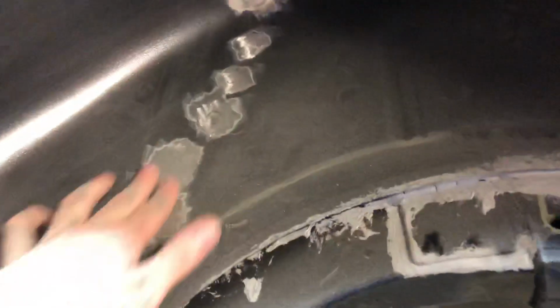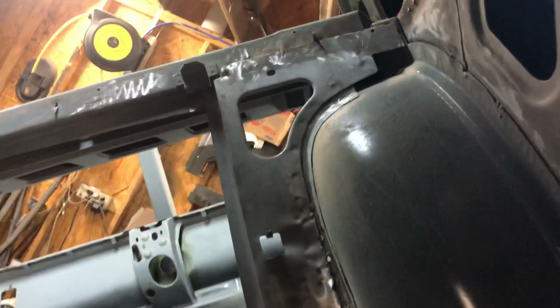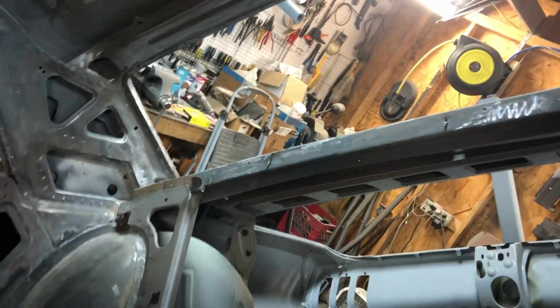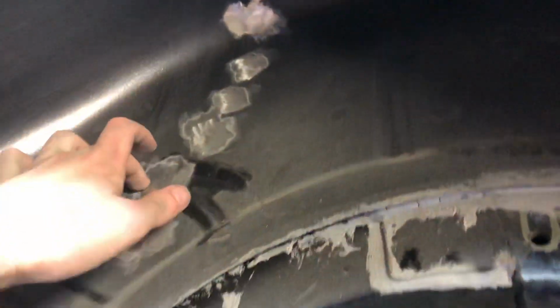All that stuff, and then of course I welded in those rear panels here to the mini tubs. Fabbed in the little extension on the ends, as you can see, that goes towards the sail panel. Welded those back on. So scuffed, these have to be epoxied again. I'm gonna have to probably epoxy down here and re-seam seal where it burned through that one. Doesn't look like it hit this one. This one, however, burned up, so I'll have to wire wheel that, re-epoxy, re-seam seal.